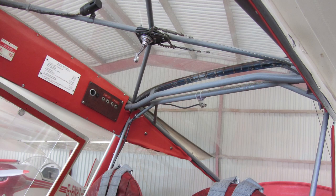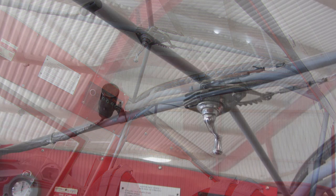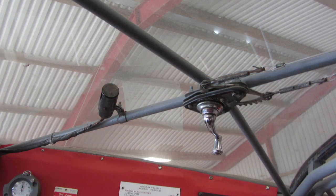And in the center of the cross is a gear and an armature and some cables and a little winder, a little crank. And the idea is that if the pilot wants to trim the nose down or trim the nose up, then this little winder is operated just above his head. So what we're going to do today is try and recreate the framework, the tubing, the winder, and maybe even the little gear or the little part gear that is involved.